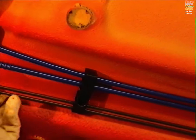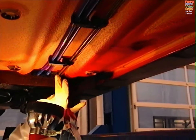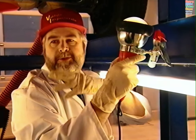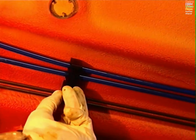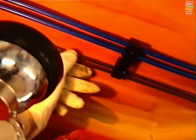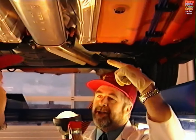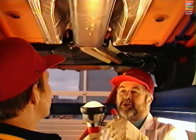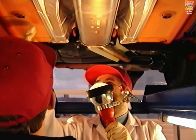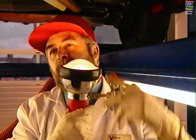Now, we would also be checking the condition of the rigid pipes on this particular vehicle — it's very new and you can see how well they're coated. A person's not allowed to remove any of this coating when testing a vehicle. I have some older brake pipe, and I'll demonstrate how we would check for corrosion on a pipe with a corrosion assessment tool. Some vehicles, you cannot see the brake pipes at all because the front-to-rear brake pipes actually go inside the body — if you can't see them, you can't test them. This brings me finally to the prescribed area. On this particular vehicle, very little of the prescribed area can you see because of the heat shield, although some of the area on both sides would be prescribed area, so we can check that much. On most vehicles, that would be completely clear and you would be able to get a good view of it.